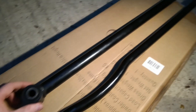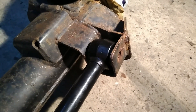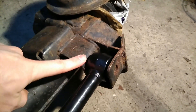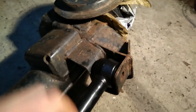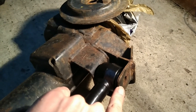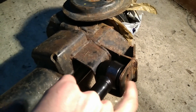Whereas on the later arms there's a left and right-hand drive version — the right-hand drive is totally straight and the left-hand drive version's got a bit of a crank in it. The last difference between pre and post-2002 Panhard rod setups is the axle. On the pre-2002 the channel comes under the bush, and on the post-2002 it actually comes across and down over the top. Supposedly the metal is also a lot thicker on the post-2002 so that it can take a higher torque with the larger bolt.